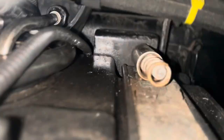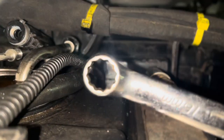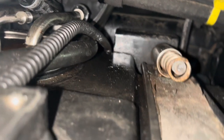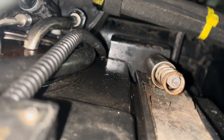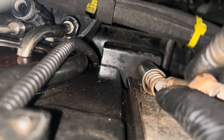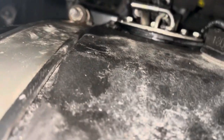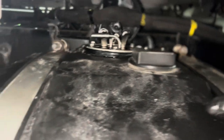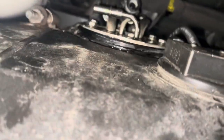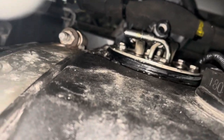Next you're going to want to take these bolts out right here — they're five-eighths, or 16mm. Start in the back. This part here is what screws into the threads there. So take this out, which is going to allow this tank to move forward. And then I'm about to get this one out and have this move slightly forward, and I'm going to quickly take this out and put the new one in.